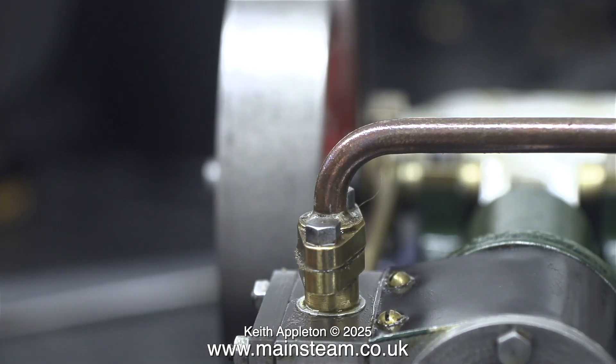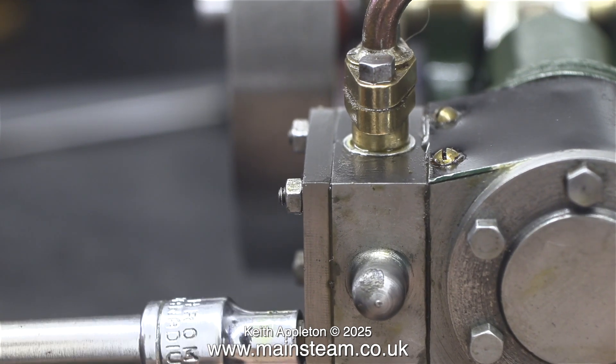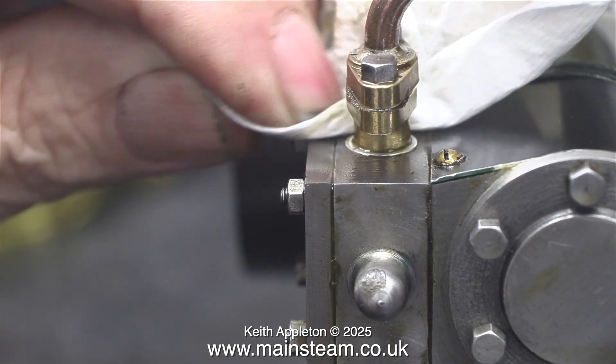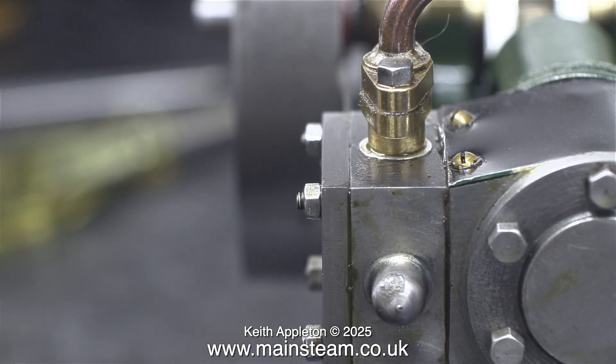As you can see, I've not managed to shear them off. There is a bit of a technique when assembling and disassembling small engines like this — you need to put just enough pressure on and no more. You'll learn after a while, once you've drilled out quite a few broken bolts, that it's possibly not a good idea to over-tighten them. I speak from experience from a long, long time ago.